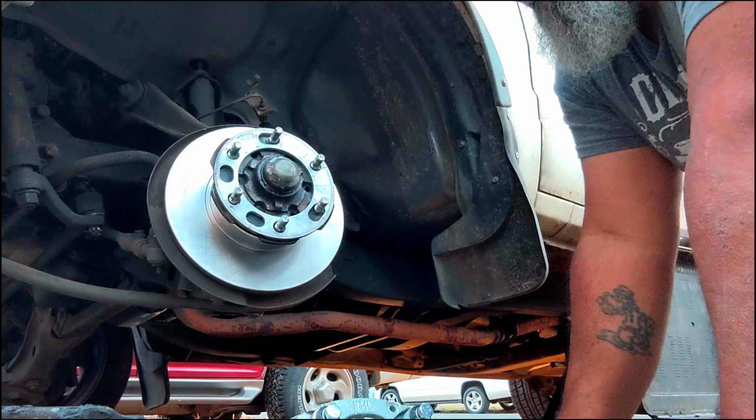Right. That's it for right now. Good enough for myself. Just hook my air bleeder to it. Bleed the whole system later. It's pretty tight. I have to break these pads in. The air bleed is a lot bigger than the one it took off. Put this cap on. Hope that works. It's better than scraping brakes. That's for sure. All right. Top off the master cylinder reservoir, rotor, brake pads, and caliper.